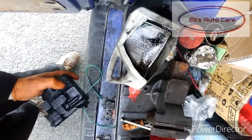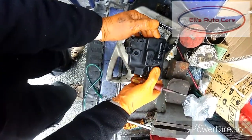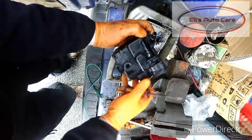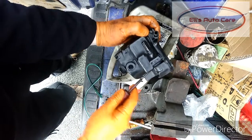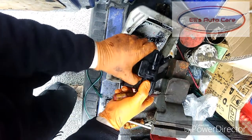Right, now we're at the back of the van, just so I can catch any diesel drippers coming out into this container here, but we need to remove this sensor. There's a clip here. If you lift the clip up with one finger and then very gently twist the sensor out with the screwdriver, it just pops free like that, that's it. Very gently wiggle it out.